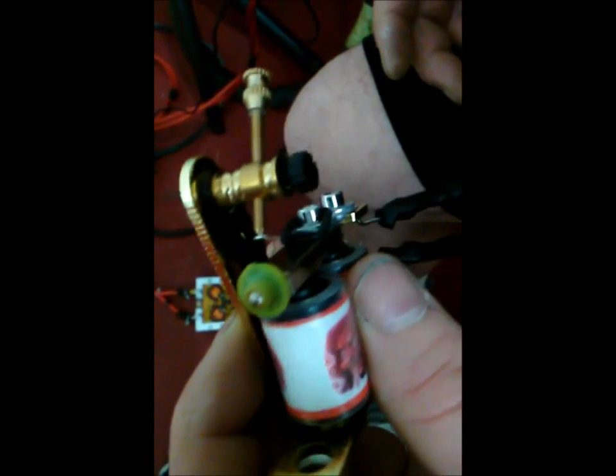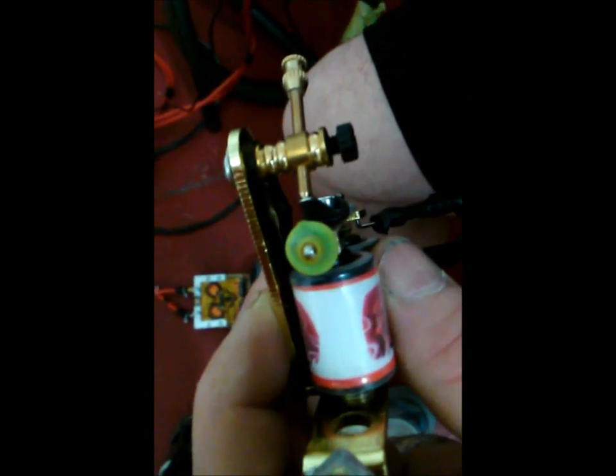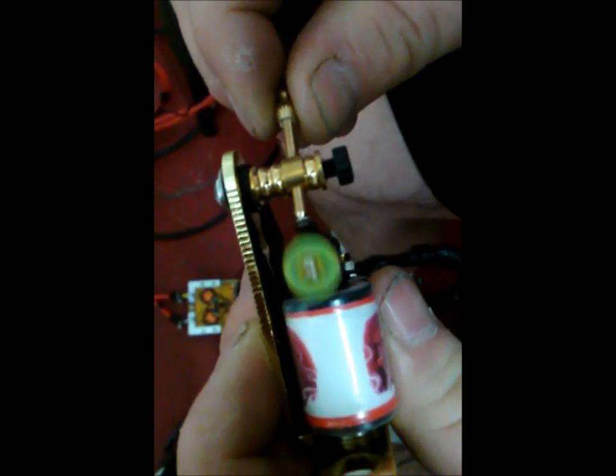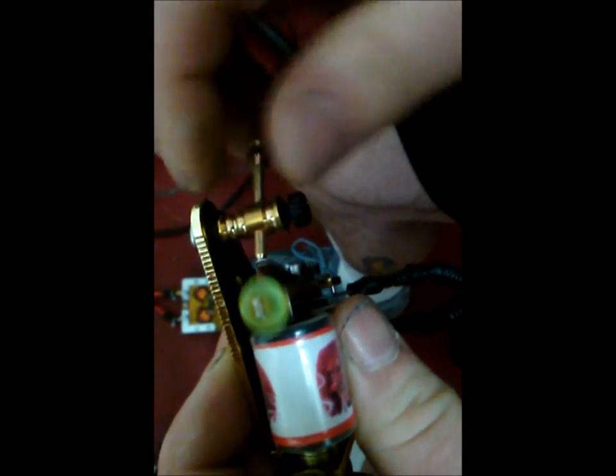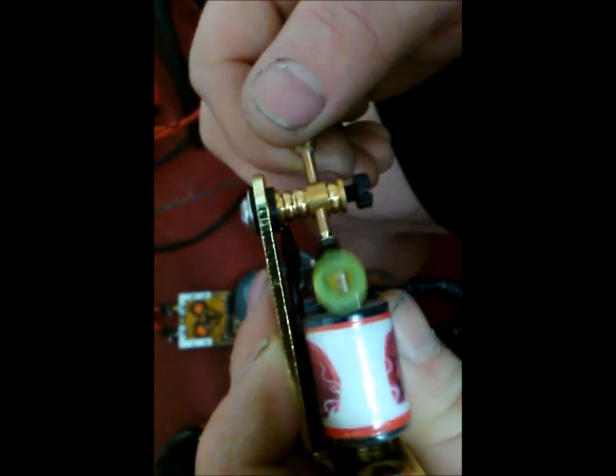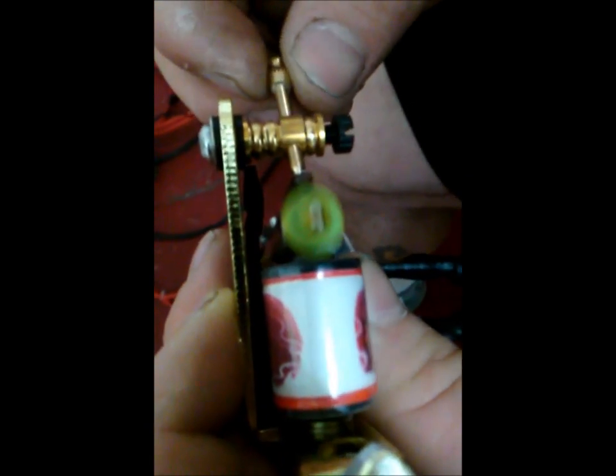What I'm talking about with that figure 8 and that loose figure, two separate circles, is right here. I'm going to show you real quick. See the armature bar nipples right here in the grommet? You can see the little two circles on there. Okay, now it's spread apart. Now it's two circles just barely touching. Let me bring it in a little closer at more of an angle. Okay, spread apart. Now they're just touching. It's a tighter figure 8. That's what we're looking for.